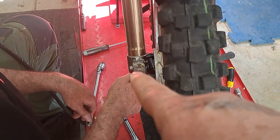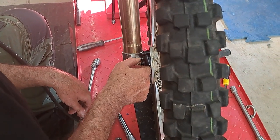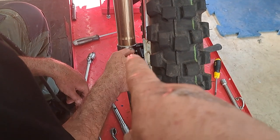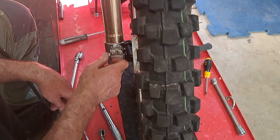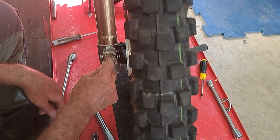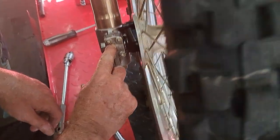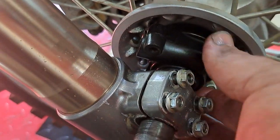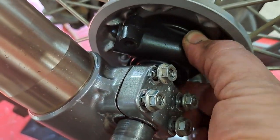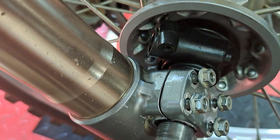And these four here are 10 newton meters. This is their torque setting, and the sequence is to tighten the two bottom ones first, and then the two top ones, with the arrow going. And there is a little arrow right where Hal's finger is. Can you see that arrow? Yep. So just make sure that when you're putting this in, that's pointing fairly rearward.